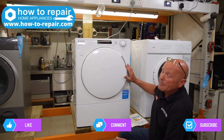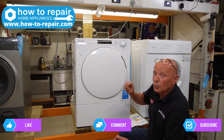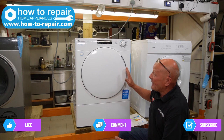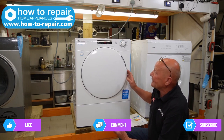The last 10 minutes of any cycle on any tumble dryer is designed for a cool-down period. The heater is disconnected but the airflow continues to cool the machine down. It's there to protect the consumer and also protect the machine from overheating.